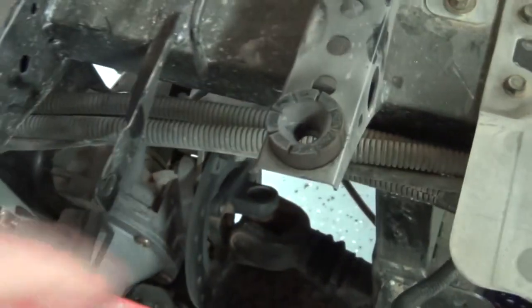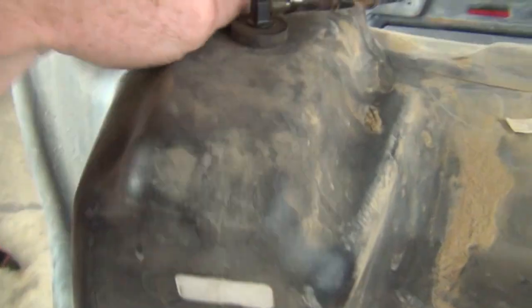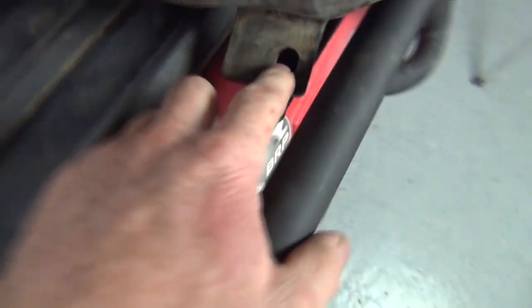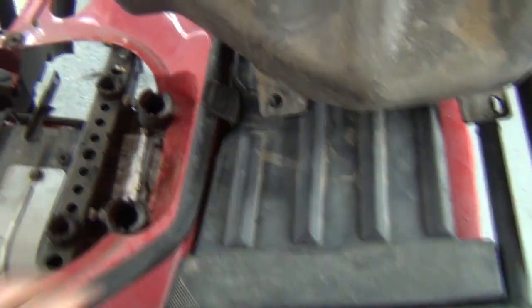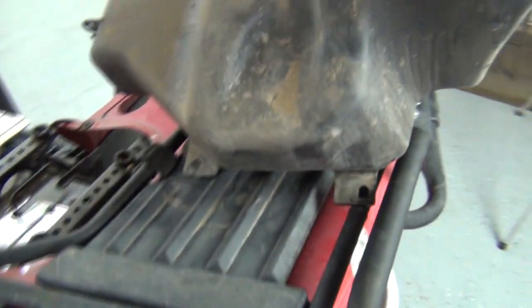That quick-disconnect hose is connected right over the rear bank on the V2 end of the motor. You'll pull that out and then unplug the wire down here. Looking from where the gas cap is: there's going to be one to the right of it, another one straight down, one on the back side, another on the other side, and then one right here. There's also a bracket for the fuel line - pull that out. They're all 10mm. The annoying thing is you can't just zip them out; you have to have a wrench on the other side or they'll just spin.